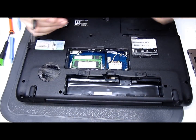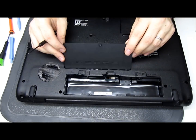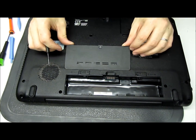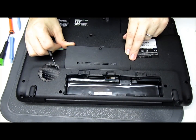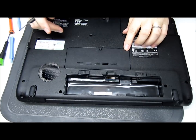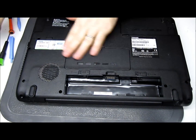And that's actually pretty much it — that is it as far as the RAM goes. Put your cover back in. You'll notice a lot of times with newer laptops, these little snaps are really easy to break, so be careful when they go under the lip on each side. The easiest way I've found is to take your thumb, hold up on one side and push in — that'll push the cover underneath there. On the other side, push in here and lift up on the middle — see how that snapped in? Very easy. A lot of times that's a nightmare and you wind up breaking them, but I do laptop repair for a living and I've done thousands of laptops, so it kind of comes easy.